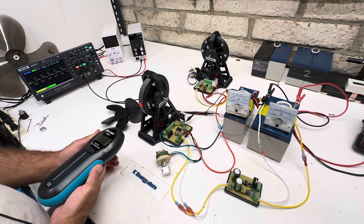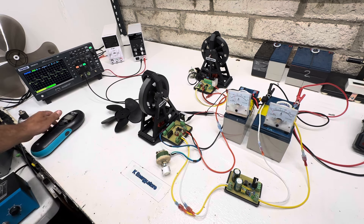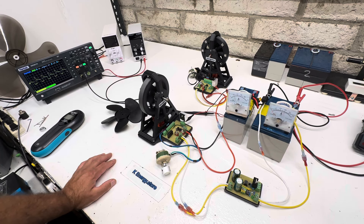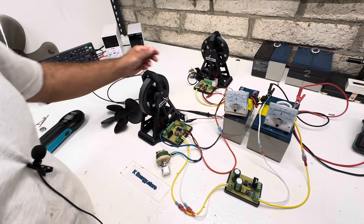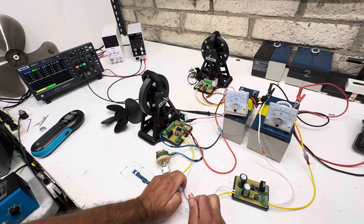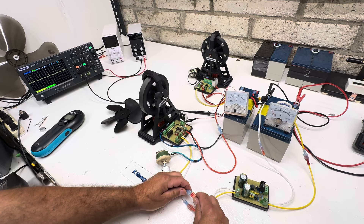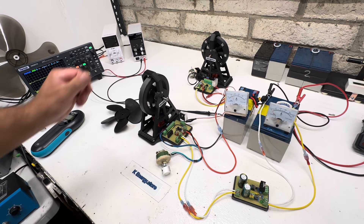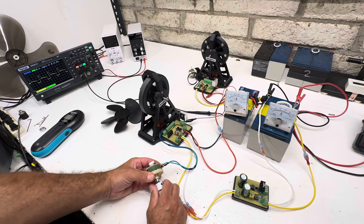We're at 1800 RPMs and this is just SG mode, so all those high-voltage spikes are getting absorbed by that capacitor. If we put this on 10x scale, you guys can see - I just connect this before it actually goes - 100, 200, 300, 400, so basically 500 volts. That all gets absorbed in the capacitor.